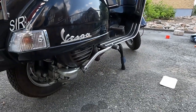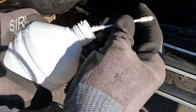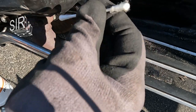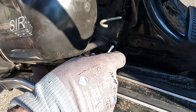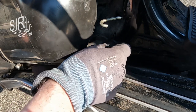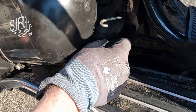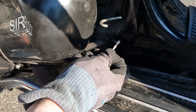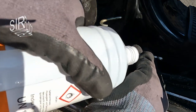Oh no, it's off again. So the issue is still not fixed. It's possible that a contact in the electrical path is dirty and makes an unreliable contact. I better clean them with isopropanol and test them. Oh yes, there is dirt inside.